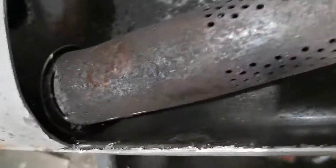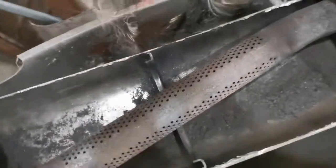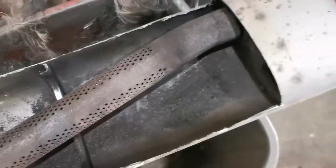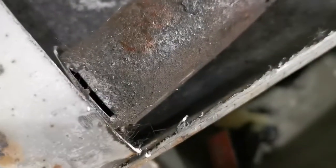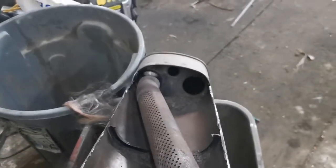I didn't want it louder, I wanted it to flow better. Okay, it goes in there. It didn't seem too restrictive, but there is a baffle plate there so it wasn't flowing straight through. This one's got a baffle plate too — you can see it's pretty strong pipe. Flowing through there, it's almost straight flow through.